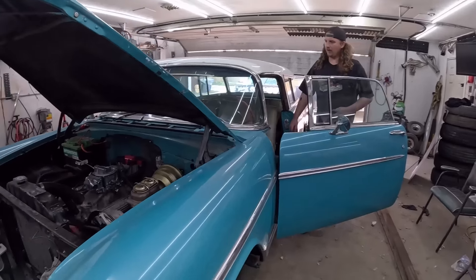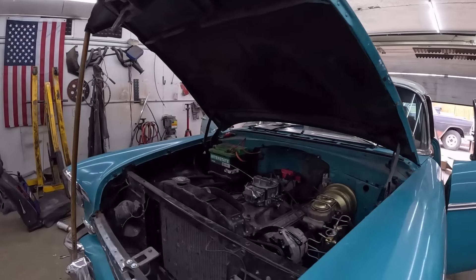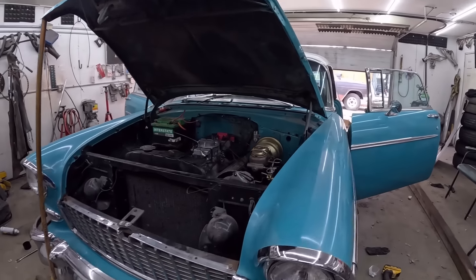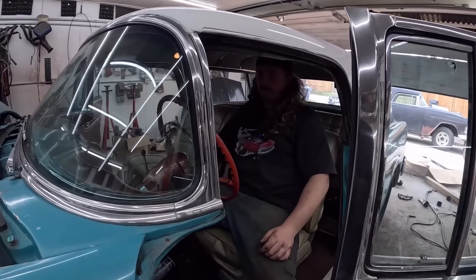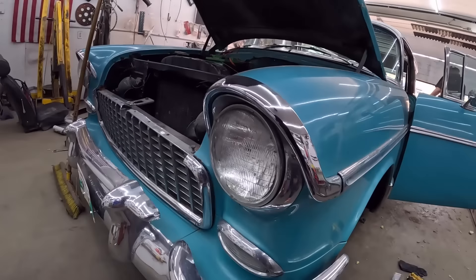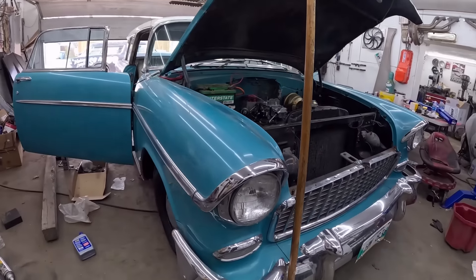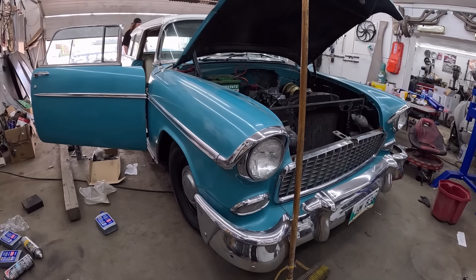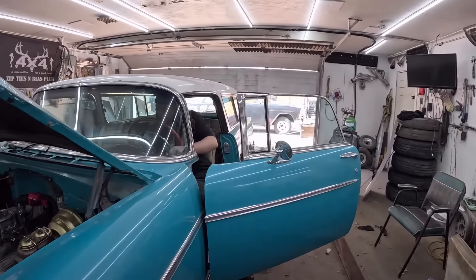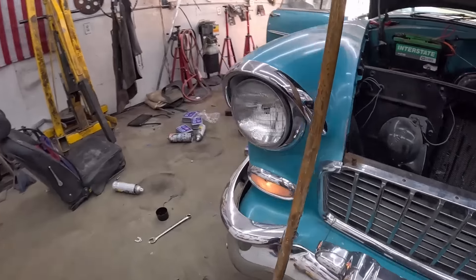Let's see — a little start, or if the battery's dead. The lights are on in here. Battery seems a little dead. Oh, the oil light works, it went off. Perfect. We have any signals? We have a back signal, we have a front — yeah, with that side — nothing. We have no right signal here. Why would that be? It's a switch — oh, it just went on. So the switch is dirty.